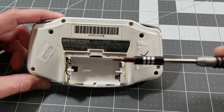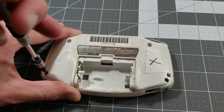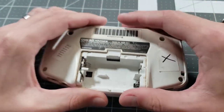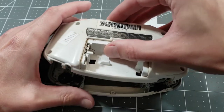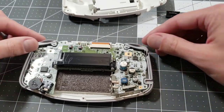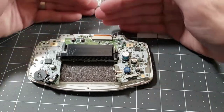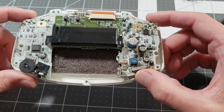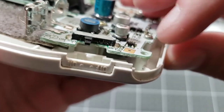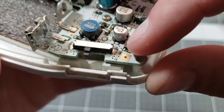There's just six screws that we'll get at with a 2.5mm tri-wing. Now I'm pretty positive there should also be a screw here, but it's already gone on this unit. I think I want to clean this whole thing off, so I'm going to take kind of everything out. We don't really need to take it apart any further than this to look at the switch, so let's look at it. There's a lot of cool dust and stuff, but I can't see much from out here. I'm going to need to desolder this metal piece on the top to actually get a look at the inside.